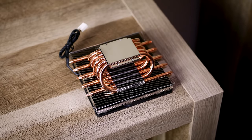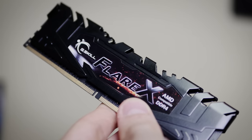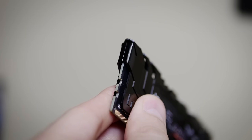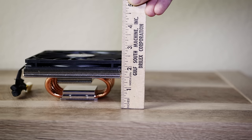If you have a Ryzen CPU you'd have to jerry-rig this cooler, and that's probably not going to be easy given the cooler's design. I recommend AMD users stay away. Intel users building an ITX rig can still mount it, though it takes effort. As for RAM clearance — if your heatsinks have a conservative profile just above the PCB it'll probably fit. I used G.Skill modules with fairly tall heatsinks and had no clearance issues — actually a few millimeters to spare. RAM shouldn't be too big a problem as long as heatsinks don't extend far above the PCB.